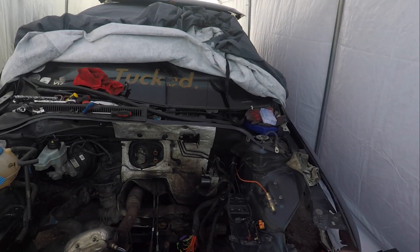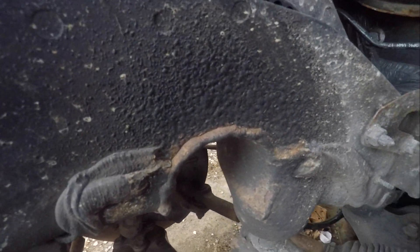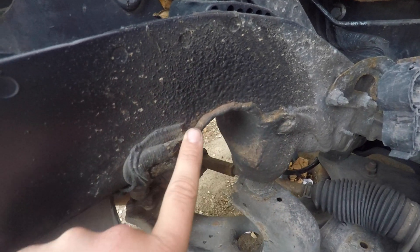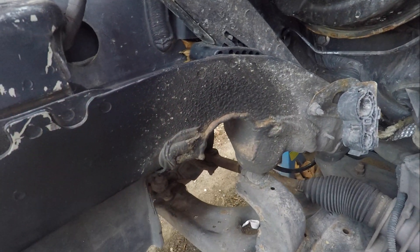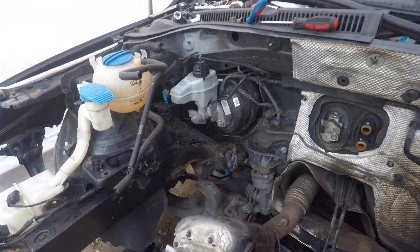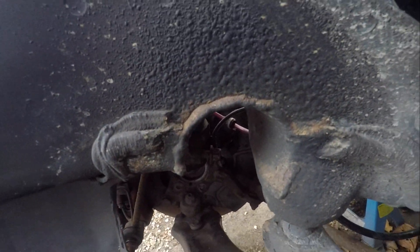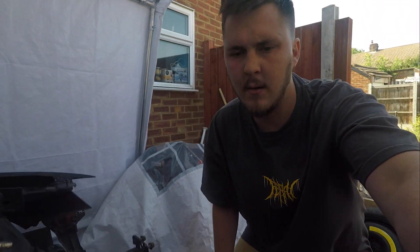You can see my original chassis notch — that's been done properly. I see a lot of chassis notches done very badly. This one is actually welded on the inside all the way around, and then it's also had some sealant put over the top. A lot of people just do the notch but don't do the inside purely because of room, but you can do it — it is possible to weld it on the inside, as you can see, and it seals it back up perfectly.